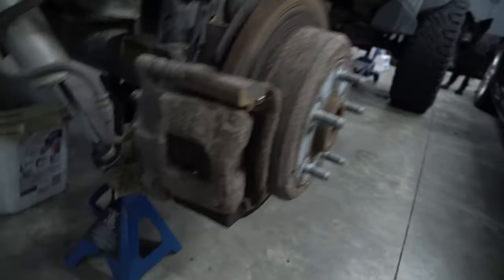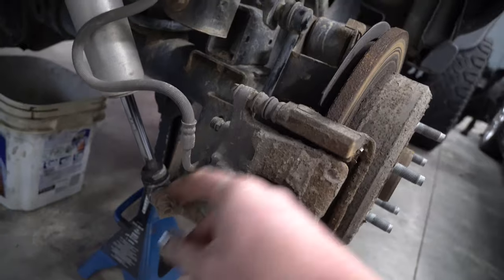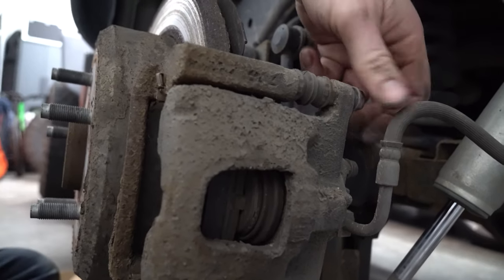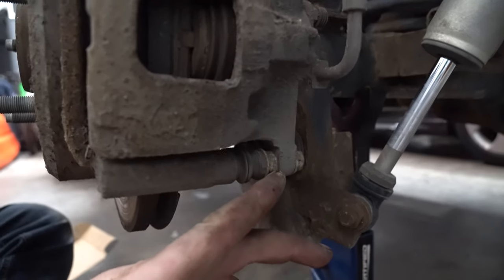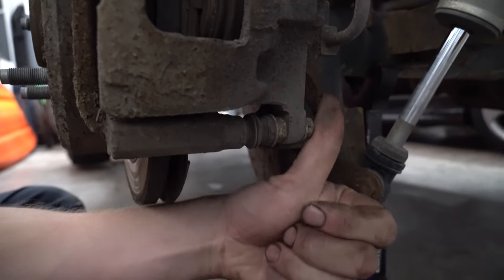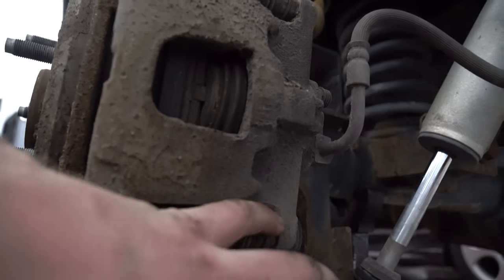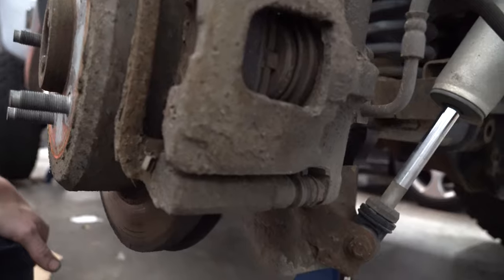You'll see that you have your caliper right here. You're going to need a 13mm — slap it on the edge and loosen the two caliper bolts off, then we're going to slide this out. If you go to loosen a bolt and you see it spinning, put a 13mm box wrench on to hold it while you unscrew. If you can't get a box wrench in there, feel free to jam a flat blade into that little groove and it'll hold it so that way when you're backing out the screw it won't spin.